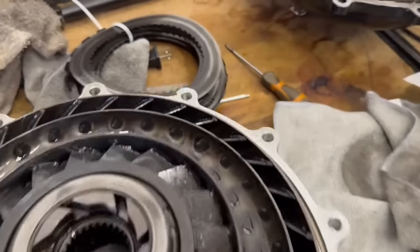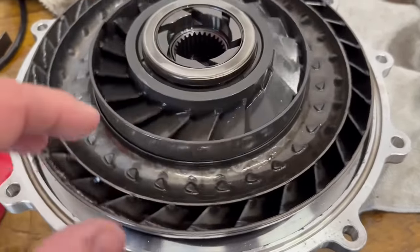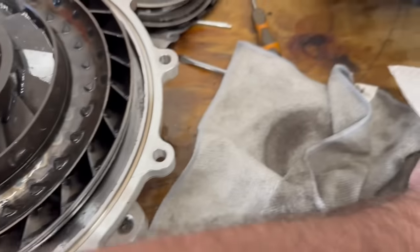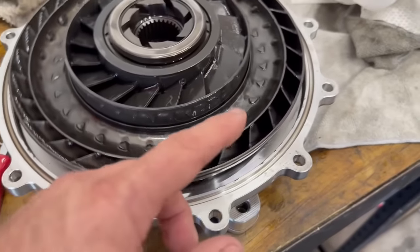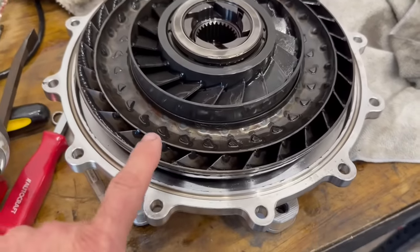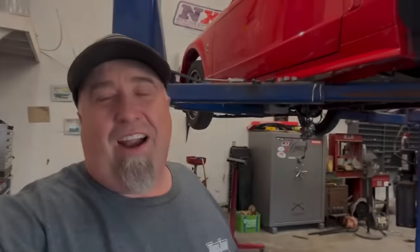We got it snapped back together — that's all the clutches. Now look: that's the way a normal non-lockup converter spins, just super easy. You've also got the sprag in there that freewheels and clicks to the right. When it's a lockup, ideally this would still spin with less friction. Go check out that seven-year-old video from Marty Chance at Neil Chance Converters — he explains how you can stack the clutches to make lockup less aggressive and load-sensitive on the motor.